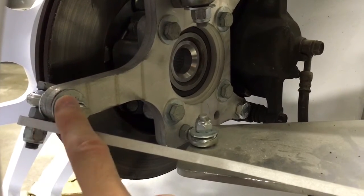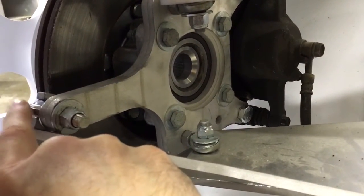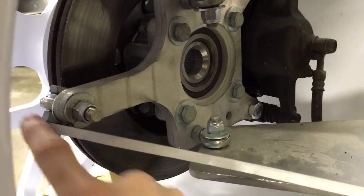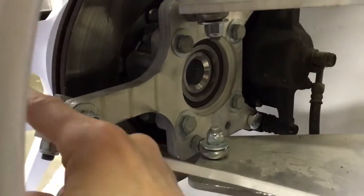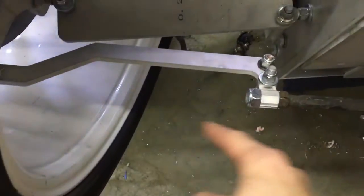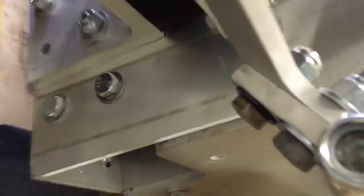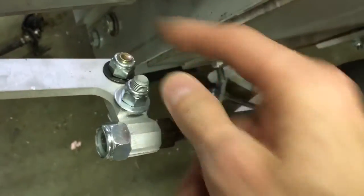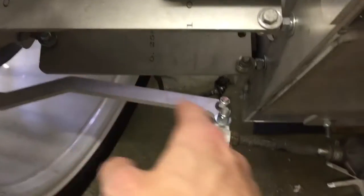Later, you're going to attach a tie rod end, also with a spherical ball end joint — a heim joint — and it will go this way. The pivot point has to be on the outside, closest to the brake rotor, for appropriate steering geometry. Otherwise, you'll get reverse Ackermann. So the pivot is on the outside, which might be counterintuitive — putting it on the inside towards the passenger and driver will give you reverse Ackermann. The bolt goes down to your steering arm, which curves away from the front of the wheel so the wheel can turn in and not intersect the steering arm. It connects to your steering rack with a machined piece using two bolts with washers and a nut on either side of the steering rack. Now you have a suspension assembled, connected to the car, with a hub carrier on it ready for a wheel, and it's connected to your steering rack.